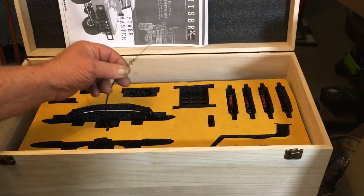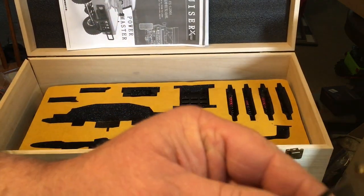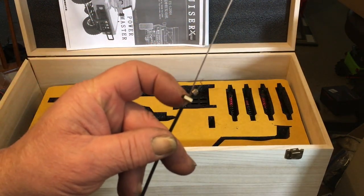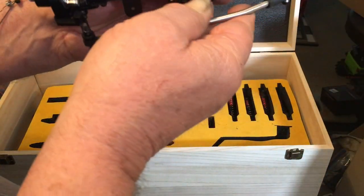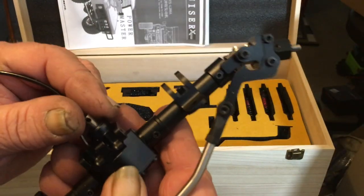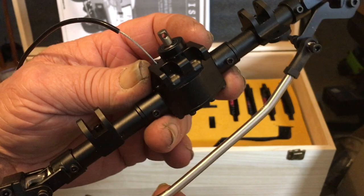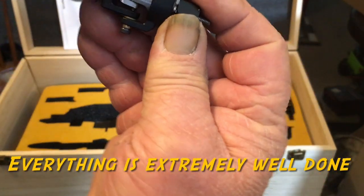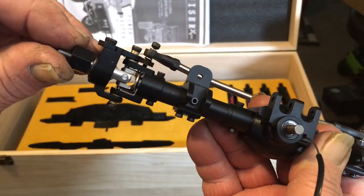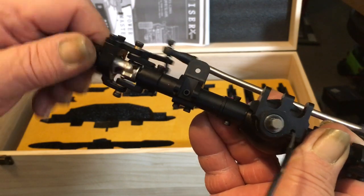You need a servo for your locking front differential, which is already assembled. Mine has the hardware on it and the mounting kit is in the bags. The axles are nice quality - they're very well made. They're all CNC machined and there's not a lot of slop. I was worried about slop in these but they're super tight and they look to have a really nice universal joint in there for your steering.